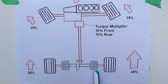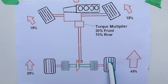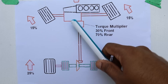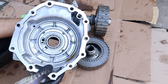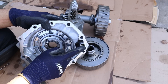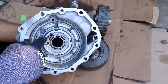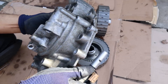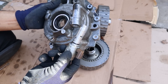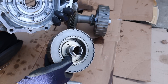If you apply a little bit more oil pressure to one side compared to the other, it'll allow you to have that torque vectoring — having more torque applied to the outside wheel allows the vehicle to rotate about its center axis and give you that yaw so you can spin out and do a drift. Taking a look at how this thing is controlled: the housing is going to take oil pressure from the oil pump, send that oil down through this cavity into the centerpiece. You can see these two holes which correlate to where this oil control valve is hanging out inside, and through pulse width modulation we control the amount of oil pressure sent through this cavity, which fills up the little holes inside of the clutch pack.